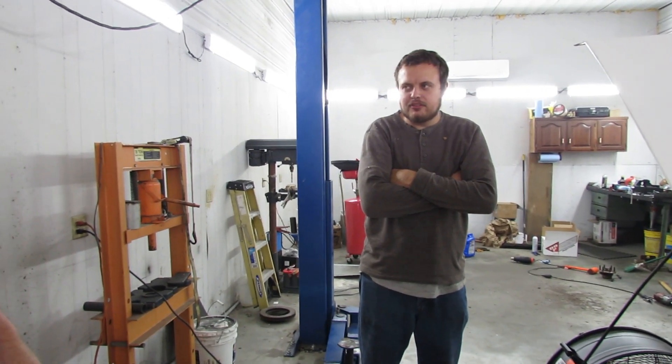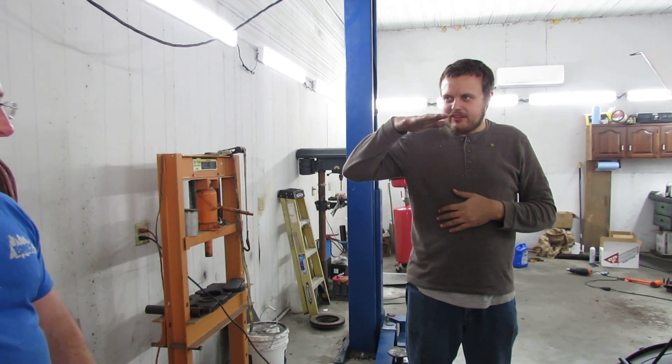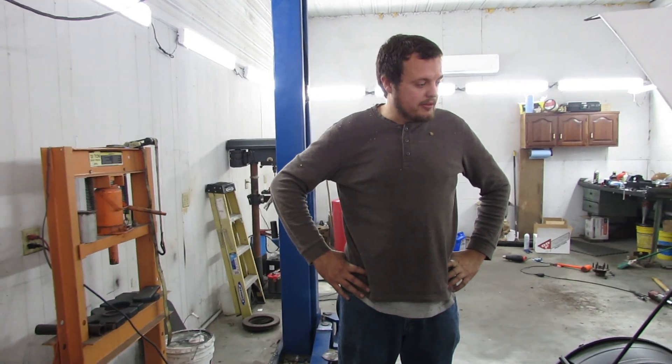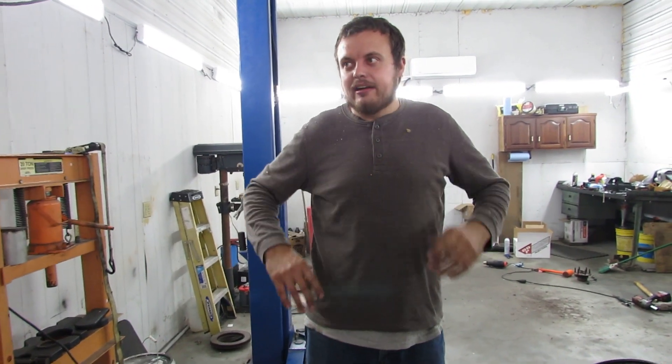It made four pounds. It skewed — went up to five and then rolled down to four. It was still fat, but I have no idea if we're way off on timing or anything. It sounds laggy on timing. It sounds very weak. But if we start playing with the VVT, it might all of a sudden wake up.